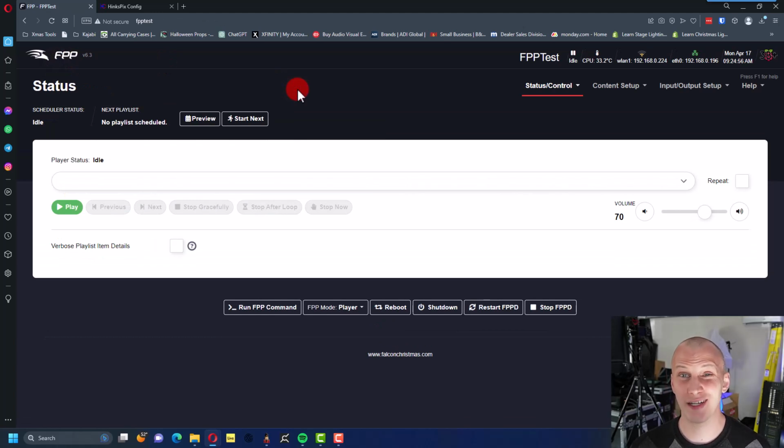We've got it all on our network. In theory, we shouldn't be able to have these both in the same IP address range, but let's give it a try. Okay, so more often than not, I recommend setting wireless, sure, have that in your standard 192.168.0 IP address range.